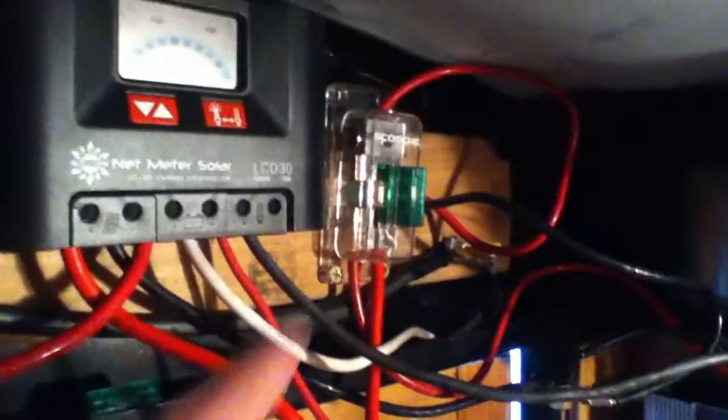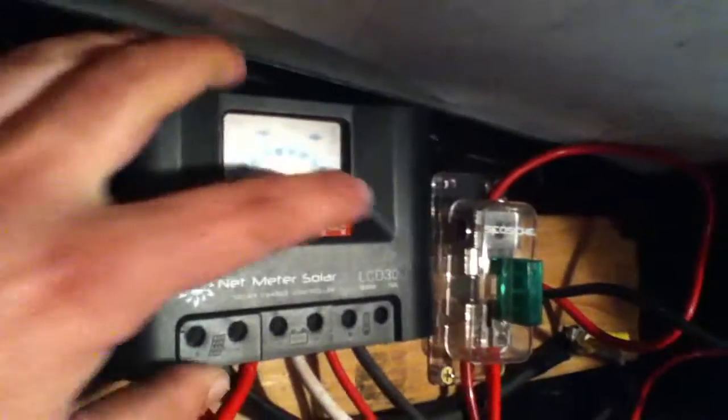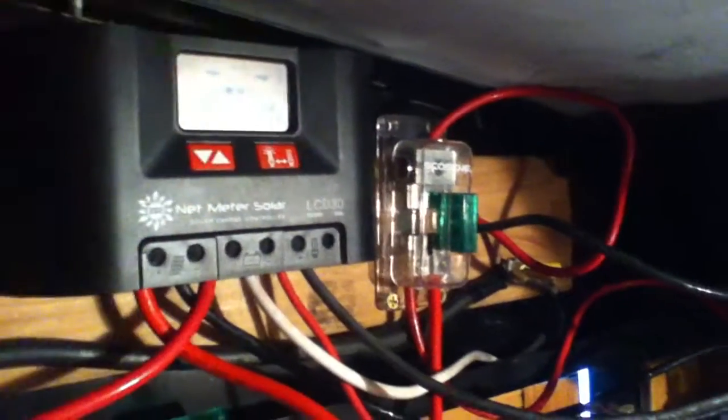The one thing I may change in the near future is the negative panel voltage side. The positive panel voltage goes through this fuse block, but the negative panel voltage is direct and hooks up to this bolt. I found out that all the positives and all the negatives need to be isolated from each other — not running on a common ground. That's apparently why the button for the lights wasn't working, because it operates off the ground rather than the positive, causing a little delay when turning lights on and off.